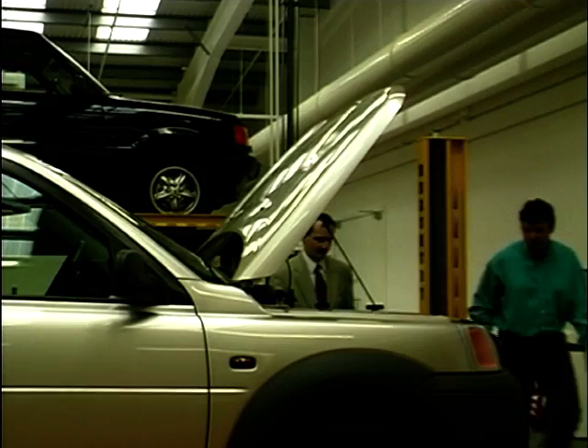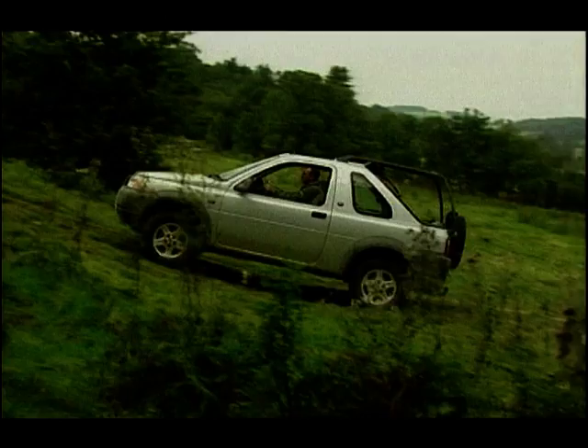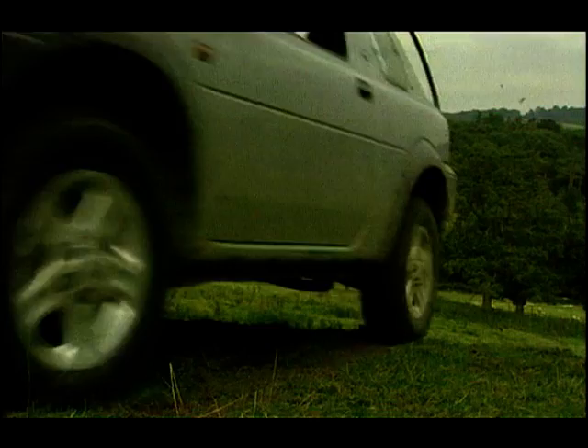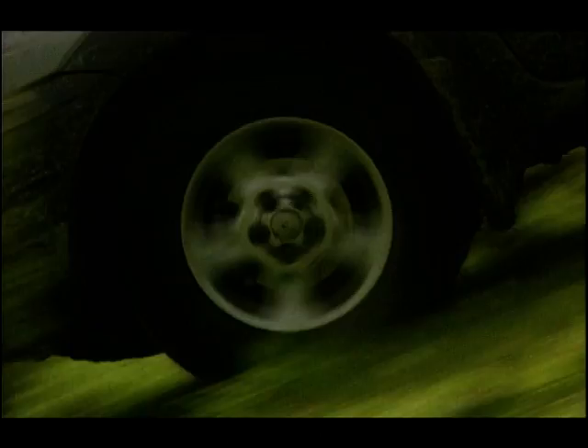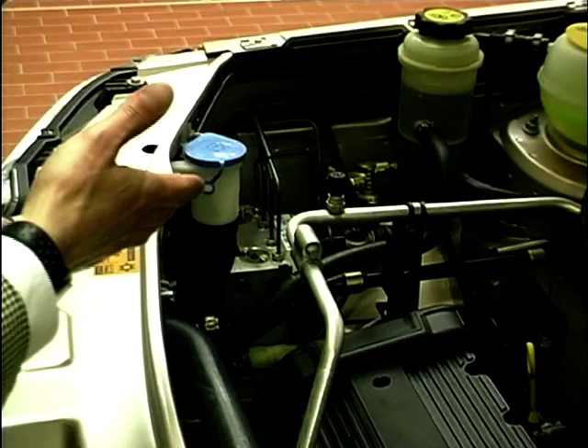So what were the problems you had to overcome with the intermediate reduction drive? The intermediate reduction drive gave us great ability off-road in terms of going up slopes. When we first built our early prototypes — which were Maestro vans with all of the running gear underneath — we did some serious off-road work and found it actually exceeded our expectations for being able to go up slopes. The problem we found for people wanting to do serious off-roading was the ability to offer control coming down slopes, which is what the dual range transfer case gives you. It's this unit here, the ABS modulator, that provides the controlled descent.